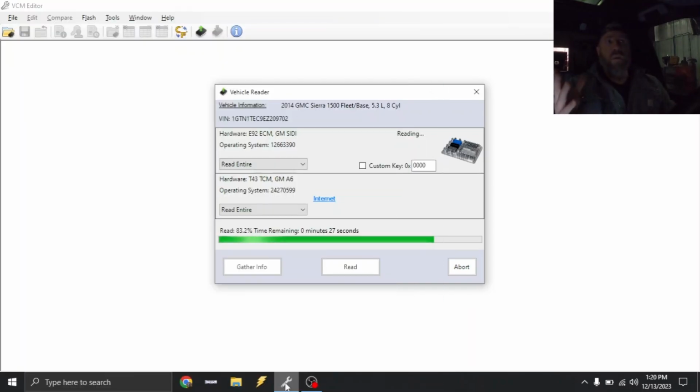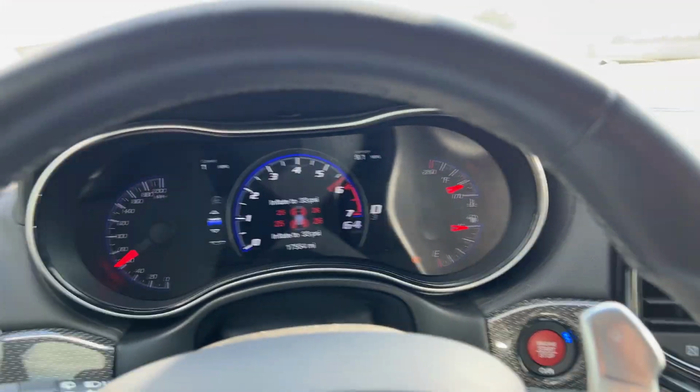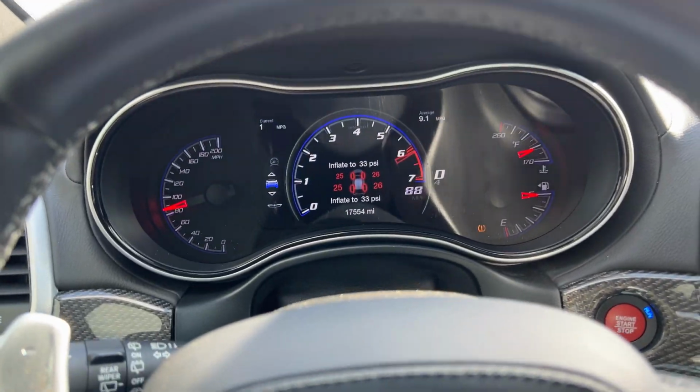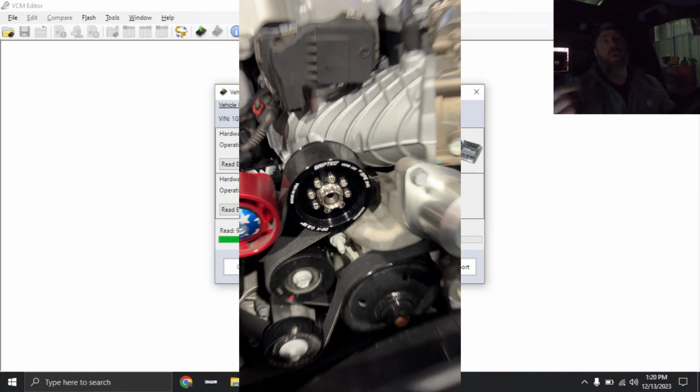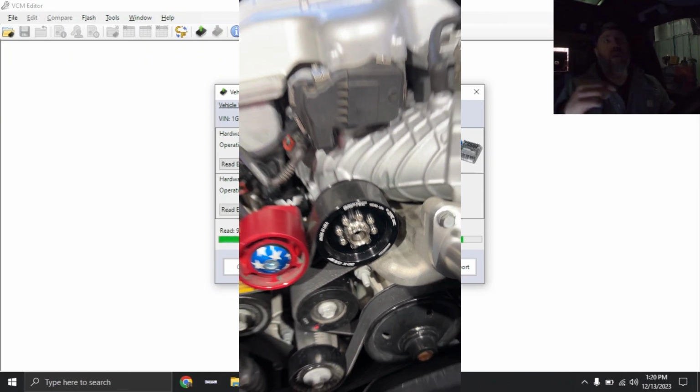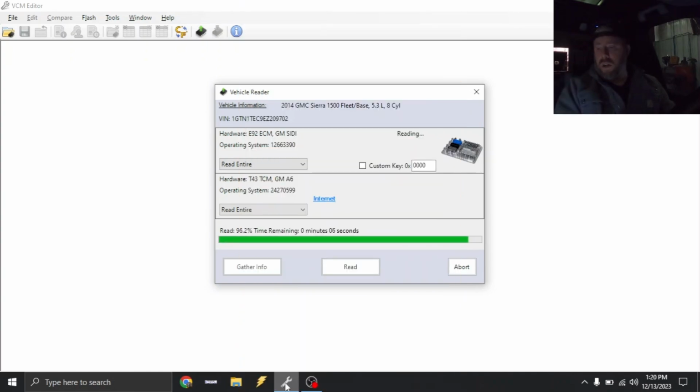And also, if you want me to go over the Trackhawk stuff, I did 3 different tunes for it: a 93 tune, a flex fuel tune, and an E85 tune. When I left there, when it had gone 10.06, it was on a 2.85 inch upper pulley. We went up to a 3.1 inch upper and 93 octane for the winter. We wanted to make sure the giveaway winner had a good vehicle that could go anywhere across the country, and then they're going to be supplied with the other tunes and the other pulleys so they can turn it back up and go 9s if they want.